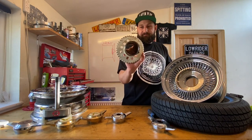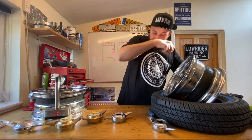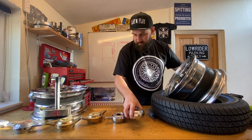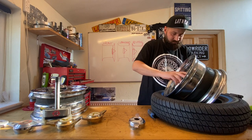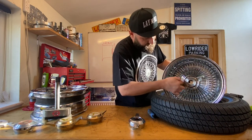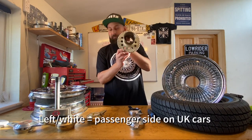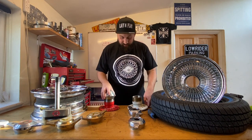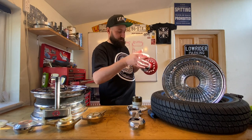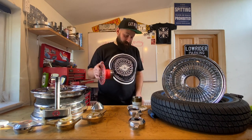That obviously bolts to your brakes, the same as that bolts to your hub. That will then slide your wheel on — make sure that you've got the right knock-off because they are sided. It's just a case of tightening it up. The right-sided ones: you'll find that the white type is for the left and the red type is for the right. The adapters on the right have got a reverse thread, and that's to stop the wheels from coming loose as you're driving. So it's important to ensure that you've got the right adapter on the right side of the car — red for right, white for left.